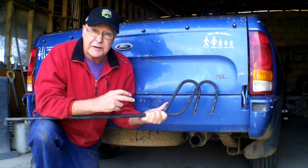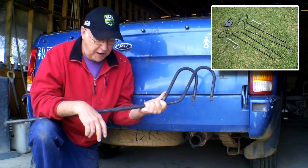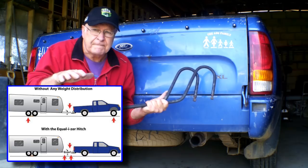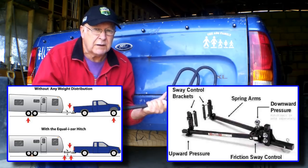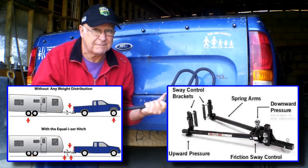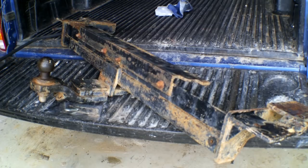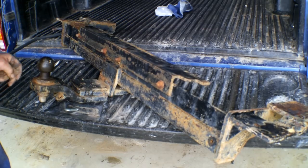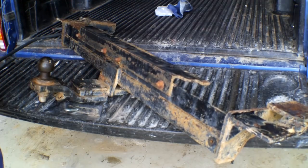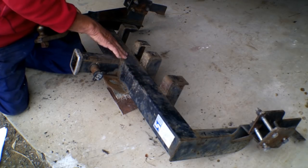I found these towing aids buried deep in the bowels of the front storage locker in my caravan. They level the car and trailer out, they reduce swaying, and they make towing a heavy load much smoother and safer. But you can't use them on most factory tow bars because the forces they generate will bend a flat tongue. So I've got to upgrade to a super heavy duty Hayman Reese tow bar.